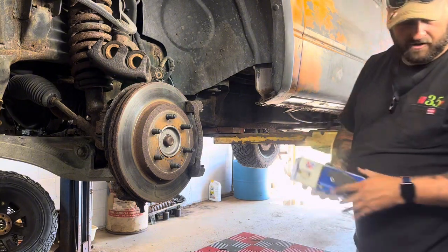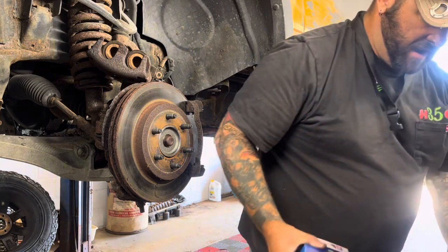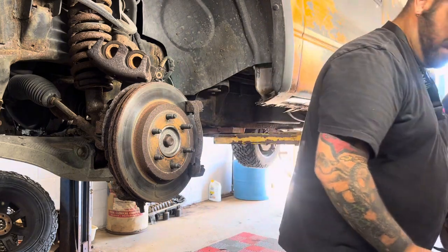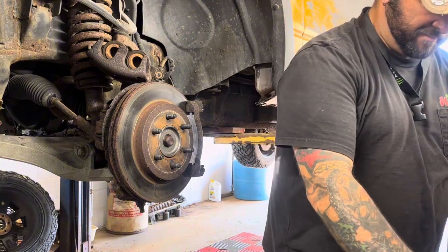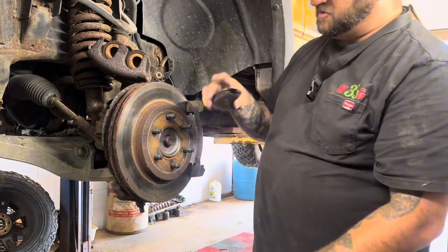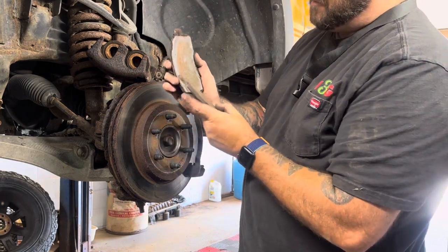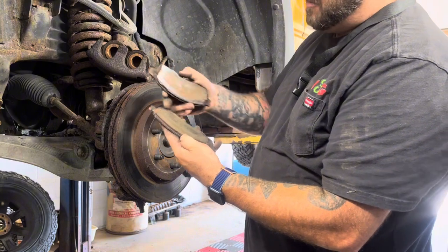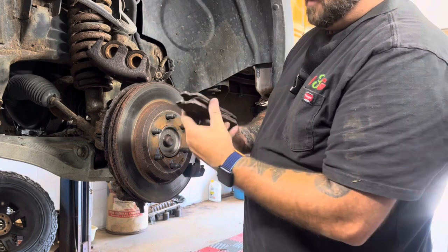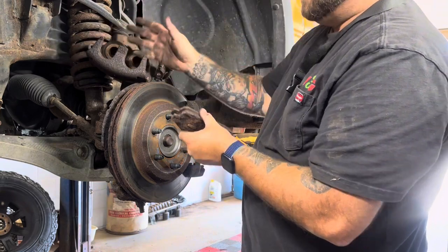So now, you take your pads. In some cases, not always, but in some cases, the inside one, which was this one, sometimes they're different. Sometimes the tabs may be different. Sometimes the length of the pad may be different from the inside to the outside. You just have to pay attention to which side came off of where, which side was against the pistons, and which side was on the outside,